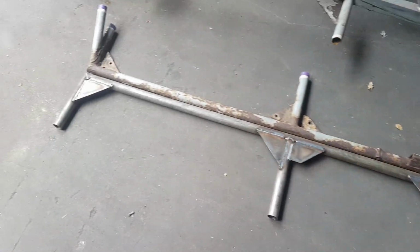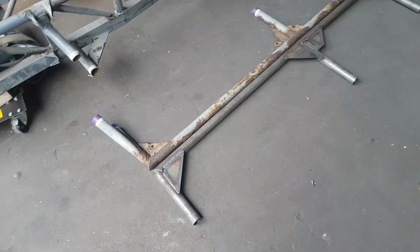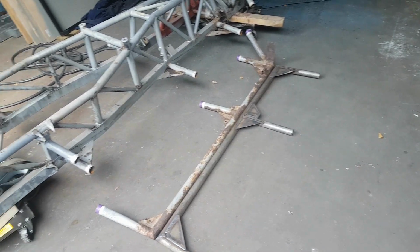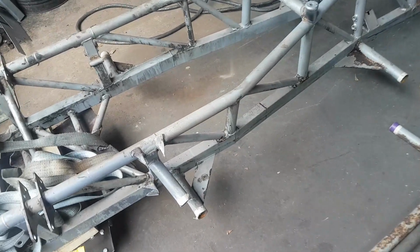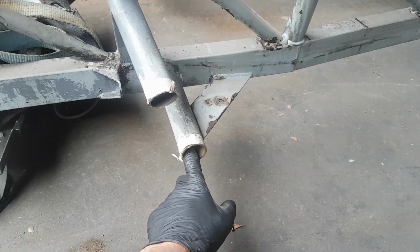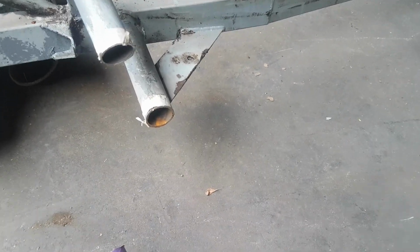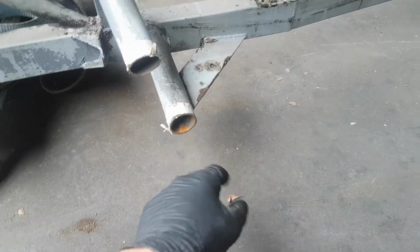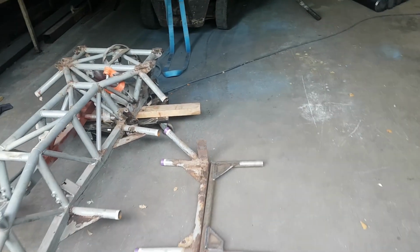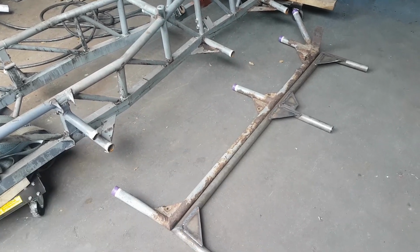Got one. This one's upside down, obviously. So that's pretty much ready to go in. We're having inserts machined, which will go in there and bridge the joint on the inside. Then we'll put a 45 degree chamfer on that and on the new piece, and fill that with weld. So yeah, again, it might not look like it at this point, but we're actually getting somewhere. And this is after, well, I cut some pieces yesterday, this is mostly just today.